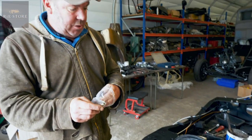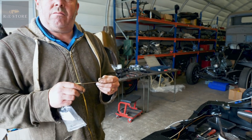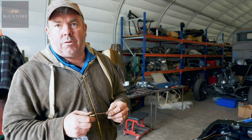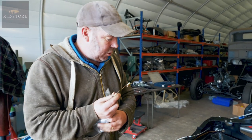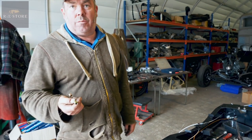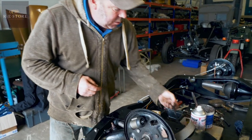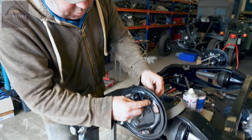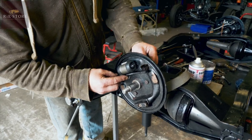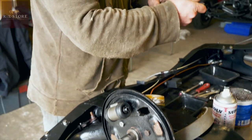You've got two different springs. Is that just a part that wears particularly quickly? Just get weak, get rust in them, brakes get hot, get cold, you know, they're always changing temperature as such. They're probably 20p each or something stupid, so you might as well do it, you know. Right, that's your handbrake actuating arm. And that sits in there. When you pull your handbrake lever, it spreads the pads. So you want a bit of lube on that.